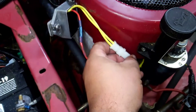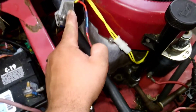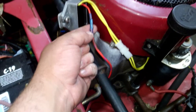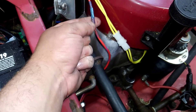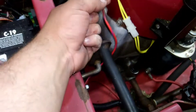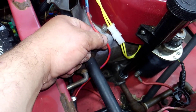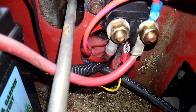As far as wiring, it's very simple. The plug from the stator plugs right onto the voltage regulator. This did have the little Briggs quick disconnect on it, but I opted to get rid of that and just used a 14-16 gauge blue heat shrink butt connector. I got some discarded outboard motor harness wire that goes to the B+ side of the starter solenoid — the battery constant side.